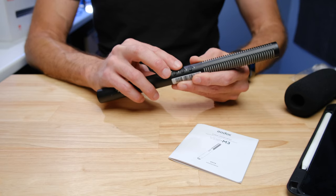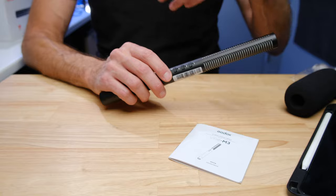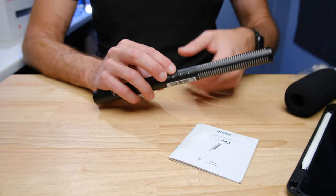If you enable that high pass filter, it's going to reduce some of the low sounds like rumbling trucks going by, busy city noise, or wind noise. It can also be useful if someone has a really bass-heavy voice that's making the sound kind of muddy and you're losing some of the detail — enabling it will clean that up and give a little bit more clarity.